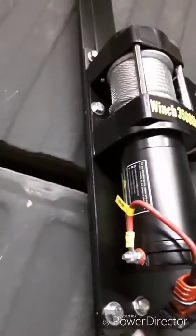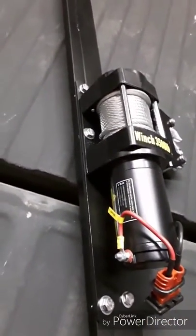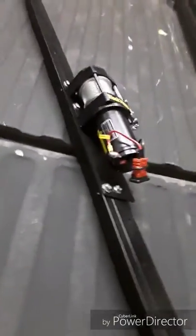That's holding this pretty steady. I bought this winch — it had some holes in it and I may have had to make extra ones — and it's laying flat on the plate, positioned as far toward the front of the truck as possible so you have the most amount of room. There are two holes in each section here. This just takes a couple minutes to take apart and put together.